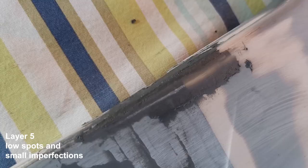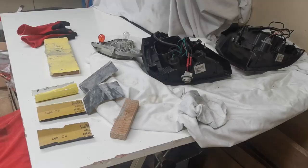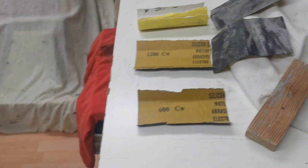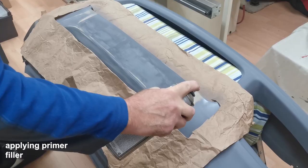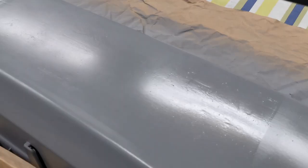Just small little patches — a little edge here, little lines there — and just try to scrape off as much as possible. We've sanded down the bumper again using 600 grit on a block and then 1200, so that's a much smoother finish. We've made a little template and now we just need to use some primer filler to fill in all the little indentations and small imperfections.